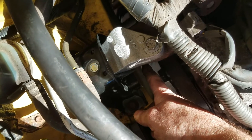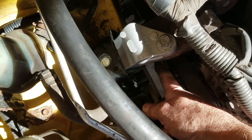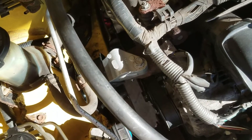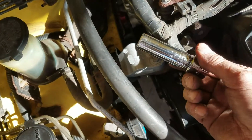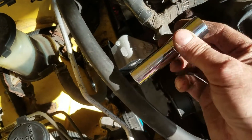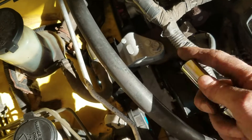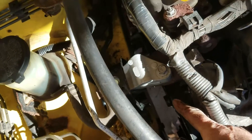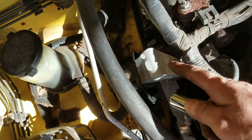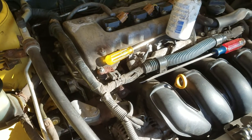The studs on this are longer, so my half-inch drive 14-millimeter socket wouldn't fit and I don't have a deep-well half-inch drive. I do have a deep-well three-eighths drive and an adapter to go from half-inch to three-eighths, so I've got ways. Let me get up under there and tighten those, then finish tightening down these three.